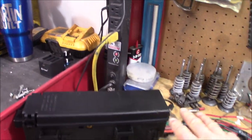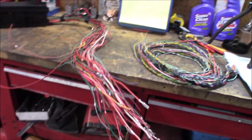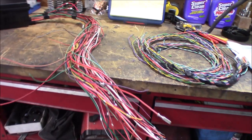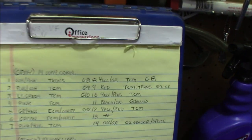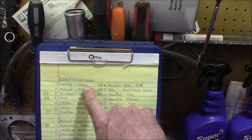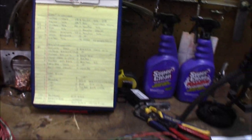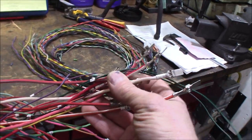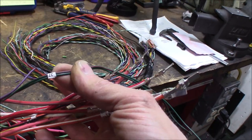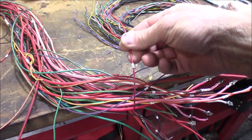So we've got that part of the harness there, plus the power distribution block and all the wires here — we're talking 47 wires that are going to have to be spliced. I've got everything labeled, and you've got to make some really good notes. I've got every connector, all the colors of the wire, where they go to, and I've got these little wire markers on the wires — that one being 37, that one labeled 36 — and all of this corresponds to notes I've made.